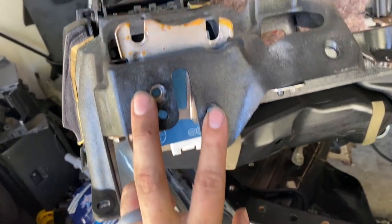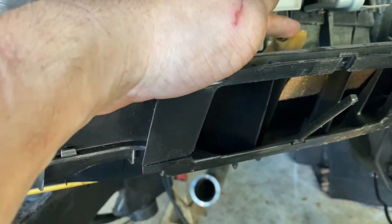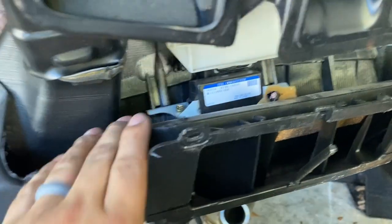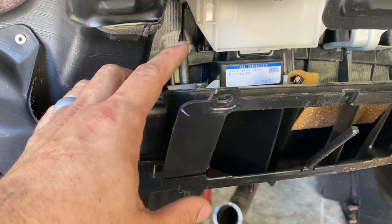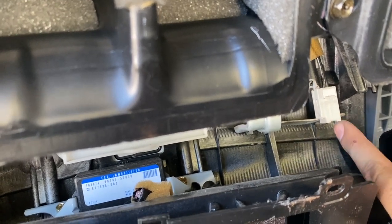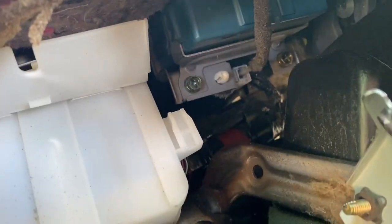Using the old one as a reference — should have looked at it first — I was able to see that I could take those nuts out. There is an immobilizer here. I cut the cables because my old car doesn't come with this ECU immobilizer so I don't need it. I'm taking it out because removing it gives me enough space to put the sensor on top of the dashboard easier. Up here you'll see that wire that connects there — you don't need to move that box, but it's going to be a pain to get that wire from the opposite end unplugged.